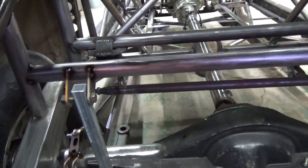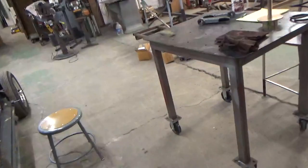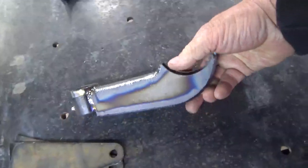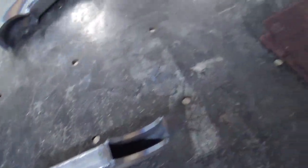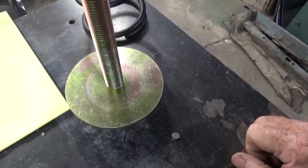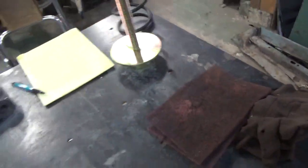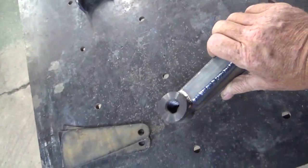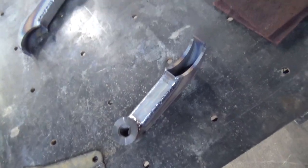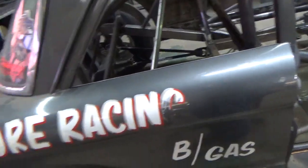The upper cup I make myself, and that bottom bracket I make myself as well. It's a piece that welds onto the housing on the bottom, and it gets an adjustable spring jack. This piece threads into that, and we can adjust our ride height with it. I buy them like this because it's got a hex in it so you can put a ratchet in — it's a circle track part from Speedway Motors. It's simpler to buy them than to make them. I move the mount in front of the rear end housing so that my pivot is more towards the middle of the car and my spring pivot allows the car to transfer a little bit better.